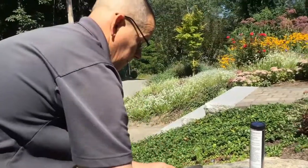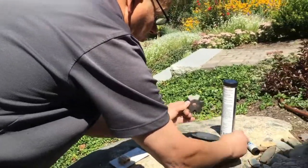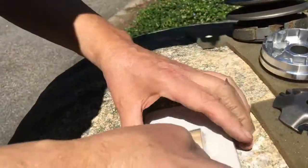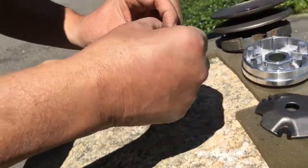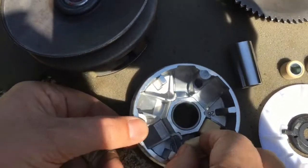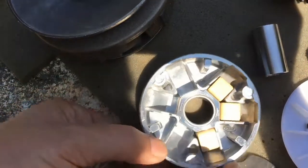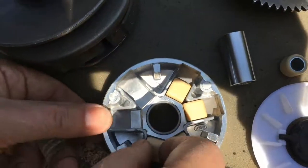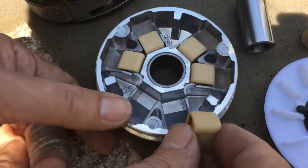Because I wanted to try some new slider weights instead of roller weights — these are your traditional roller weights, and there's six of them — I'm going to try these sliders. They go in a little bit different orientation. They're supposed to give you a performance increase because they can make the bike go slightly faster and basically go to a lower and a higher gear ratio than what the rollers can do. You can look up Doctor Pulley sliders — it will show you the actual orientation that these are supposed to be in.